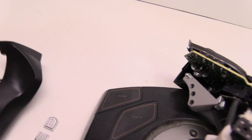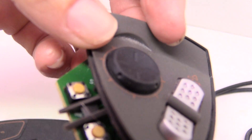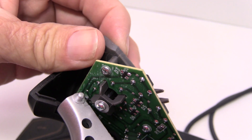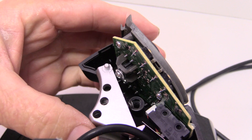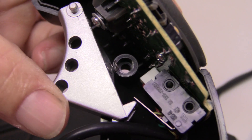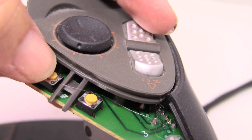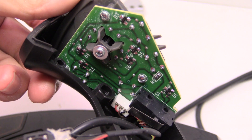Here on the handle, there are a couple of buttons which are now right here, and they control these two buttons. And there's your hat switch. The back of the hat switch is right there — I'll take this circuit board off for a closer look. And then there is your trigger. The little spring was up against the screw hole, and that just engages this switch down here. Pretty neat. There are also a couple more buttons — the same kind of little momentary contact switches.